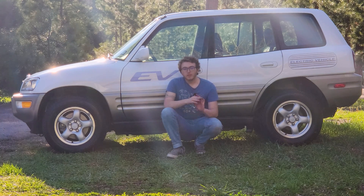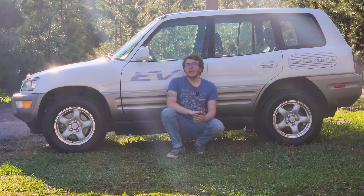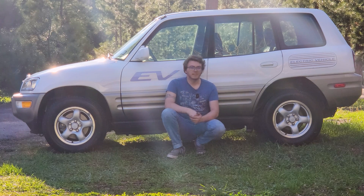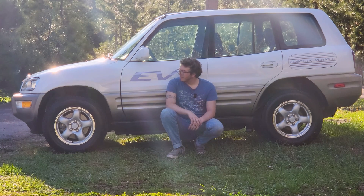So what's the plan with this car? In a couple of days I'm going to be getting the diagnostic equipment, because this car can be diagnosed without dropping the entire pack to see its condition. We'll see how far gone the pack really is. If the pack can be recovered, I'm going to do everything I can to recover the factory pack because it's just cool. But Panasonic doesn't make the cells and hasn't for a long time, so I can't really get replacement parts. If the pack is completely done, I'm going to have to talk to Kyle — it's his car. If I get my way, I'd love to put some Tesla packs in here, extend the range, make it a little bit cooler. But if the pack can be recovered, I want to recover it.